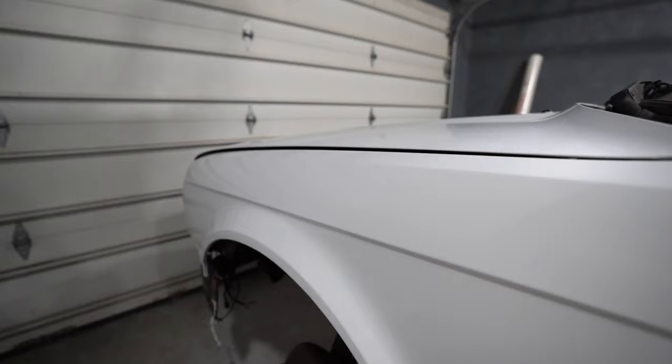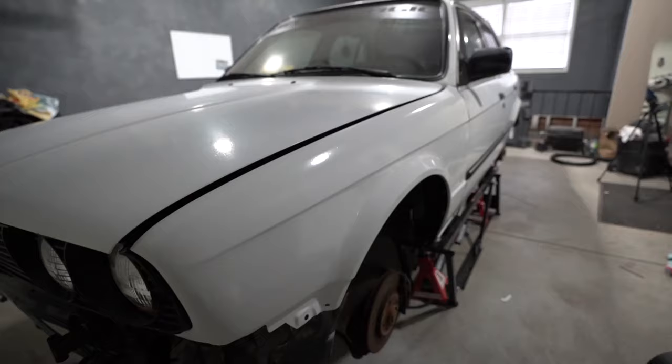It's been a couple of days and the paint has dried up really nicely — it looks so good. Now we do have a little bit of orange peel on the paint. That's from the paint underneath the top layer drying at a different speed than the top layer. So it does have a little bit of that orange peel, which is just a grainy look in the paint in the right light. This looks so much better than the house paint that somebody else decided to paint this car with. I would definitely recommend picking up a can — it made for super fast, easy work. Normally with other spray paint cans you get areas where you paint more or less and a lot of streaking, but with such a wide fan it really made it easy.